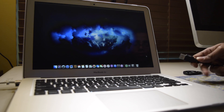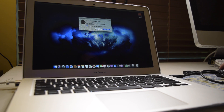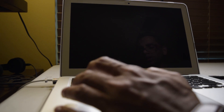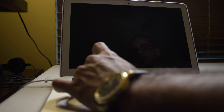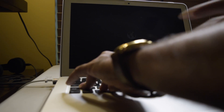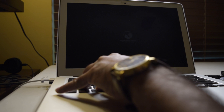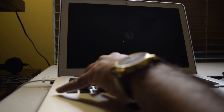This computer is running macOS Catalina, but we cannot install Catalina on our mid-2011 iMac. Before installing, we have to insert that SSD into the USB adapter and connect it to the laptop. Now we can see there is a hard drive showing — that means the SSD is being detected. We restart the computer and start it by pressing Command, Option, Shift, and R. It says internet recovery has started.